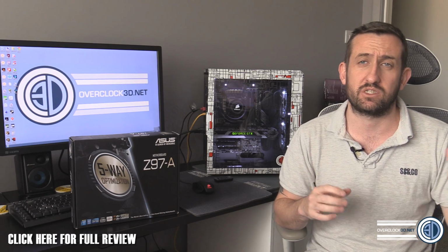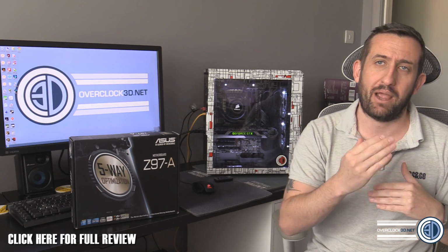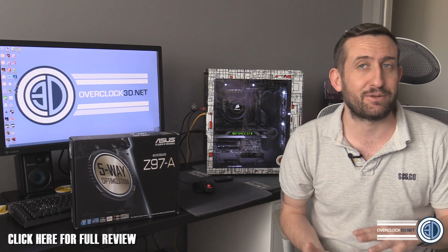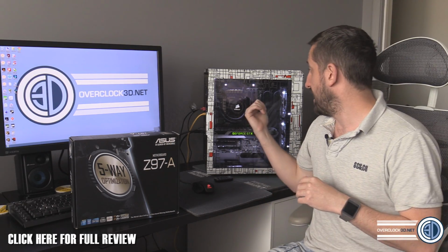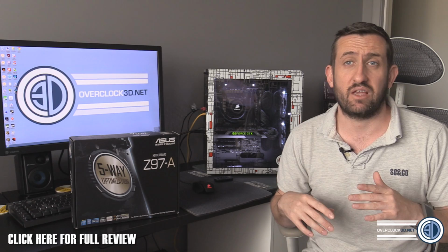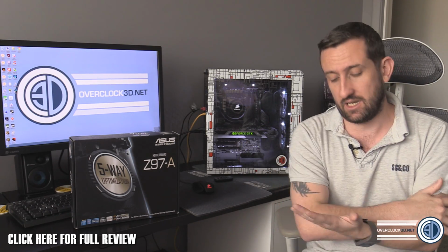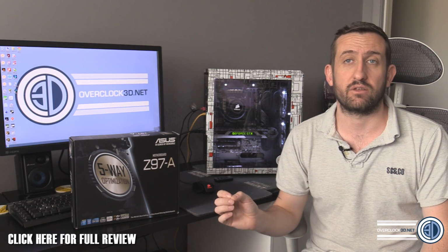Back in the old days when CPUs were ridiculously power hungry and were sapping everything, you needed more power phases to get a cleaner, more stable overclock. But as things have got more efficient, you don't necessarily need all those power phases anymore. But you'll still see it, as the Z97A has got 8 power phases around this CPU, but the Z97 Deluxe has got 14. We don't know whether you're going to even need 8 yet. So we're right at the very beginning, wiping the blackboard clean, and we're going to be starting to take new notes.